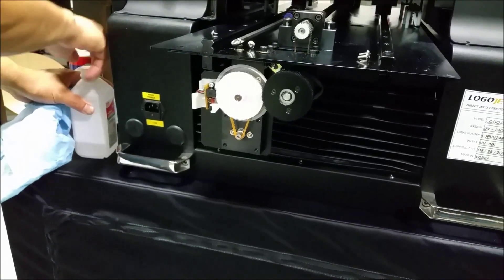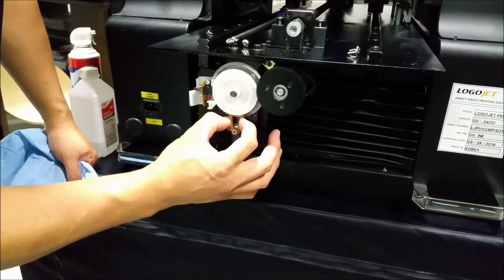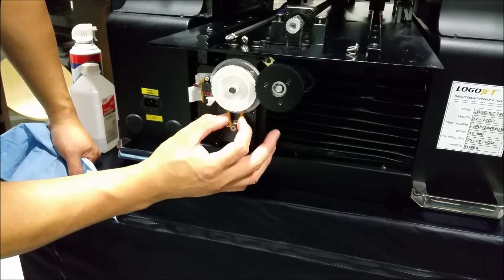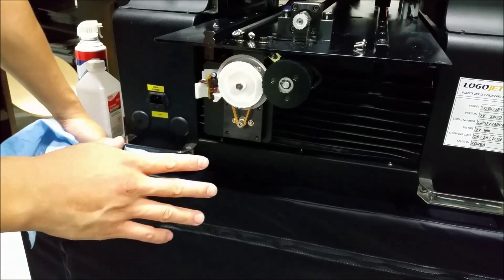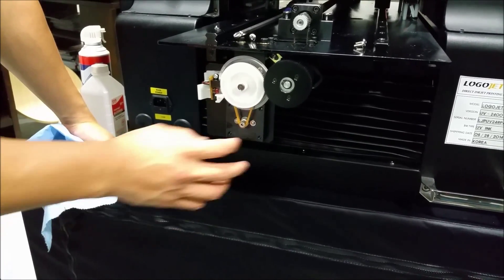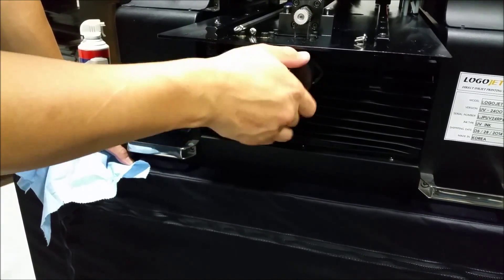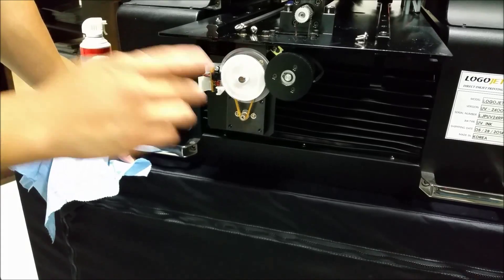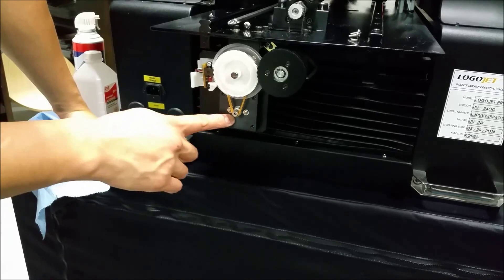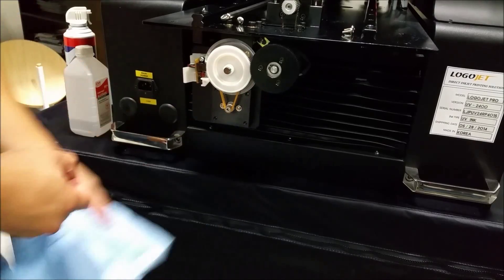The other important item to inspect is the timing belt. When I squeeze the timing belt, see how much give it has — it's about a two to three millimeter give. If it's too loose, you're going to get paper jams; if it's too tight, you're going to get paper jams as well. This is an important part of the drivetrain for the bed itself. If it needs to be tightened or loosened, it's held with two Phillips screws — you loosen those, re-secure the DC motor, and tighten it back up.